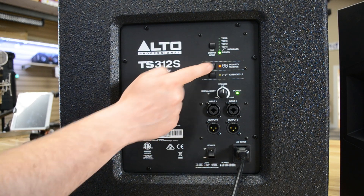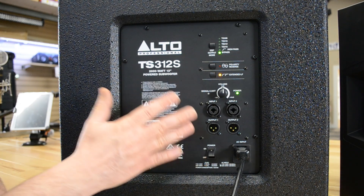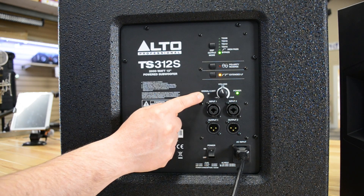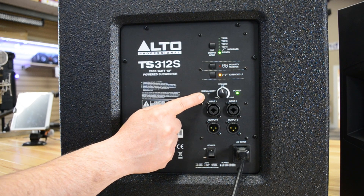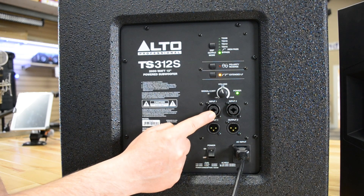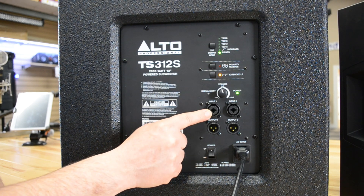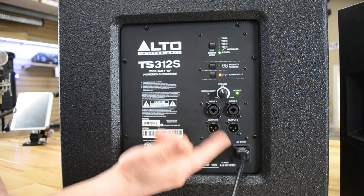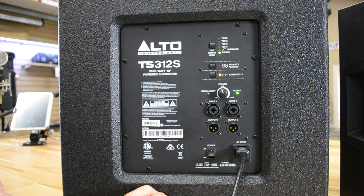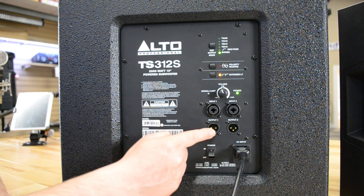We can also reverse polarity on it. If we're going to play it at lower volumes but we do want to kick up that bass, we've got an extension — we can expand the low end on the unit. Then under that, there's what they call volume, which is the gain control. It also has a signal and limiting indicator built in — this light will turn green and then turn red, which means you've pushed it a little too far. Under there we have combo jacks, which means I can use either a three-pin XLR or quarter-inch balanced or unbalanced. I can also use both jacks if I only have one sub, or run one sub independent from the other if I have two.